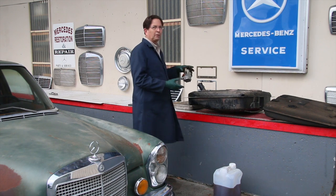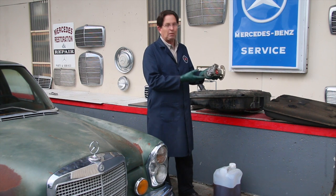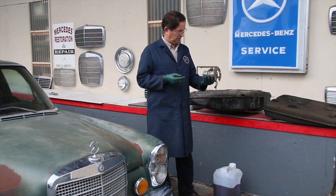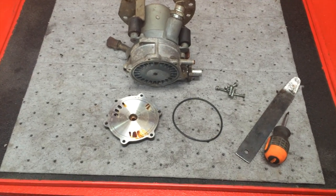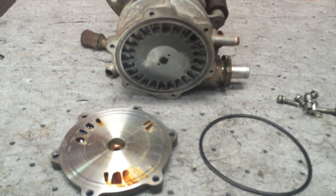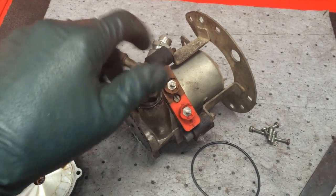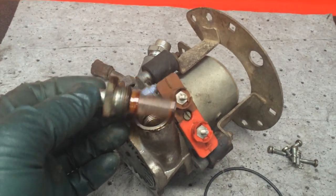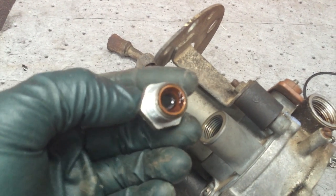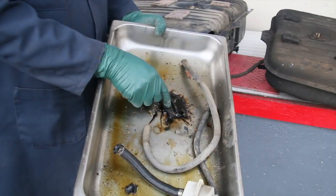So what I'm going to do is use this fuel tank — at least to get the engine running. This tank is clean, it's not rusty, so that's going to be the first thing. The next thing is making sure the fuel pump is working properly. When I pulled this fuel pump, I could tell by looking at it that it was probably replaced when the engine was overhauled, because this does not look like an original pump. There's a screen right here — a finger screen — and over here there's a check valve.